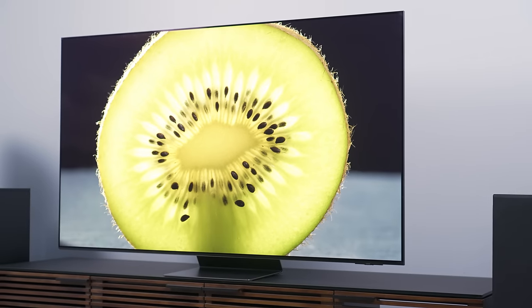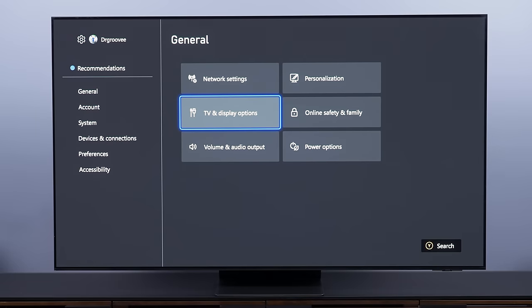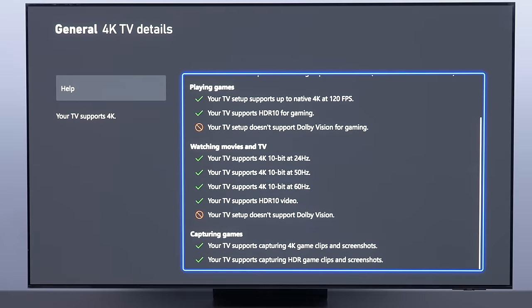Speaking of HDMI ports, you get four full-bandwidth HDMI 2.1 ports, so no limitations there, which is great news for gamers who want to get the most out of their next-gen console. There's no support for Dolby Vision, be it for gaming, streaming, or disc playback, though. And so long as I'm talking about gaming, I'll mention that this TV does a great job of auto-labeling all game systems — lots of different devices that you might connect to it, actually. And it goes into low-latency gaming mode automatically, offers a comprehensive gaming dashboard too. The TV also supports VRR, and it goes up to 144 Hz, all while maintaining an input lag right around 9 milliseconds. From a gaming feature standpoint, this TV is loaded.